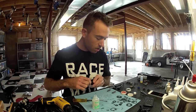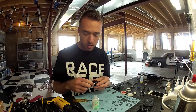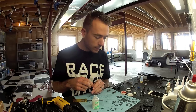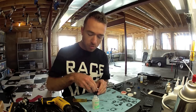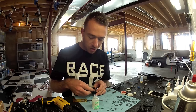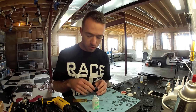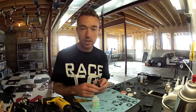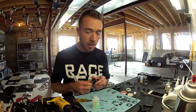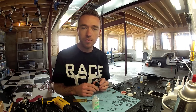Just remember: you want to put the grease where the bearings go, grease on your out drives, and make sure you fill them up properly — not overfilling. When you put your cap on, you don't want oil coming out of the screw holes. When you screw your screws in and oil comes out of your screw holes, that means you have way too much oil and that will make your diff leak. Hopefully this helps you out — thanks for watching.